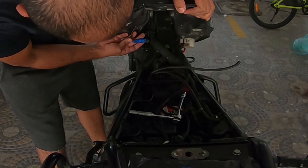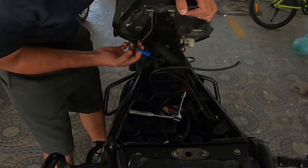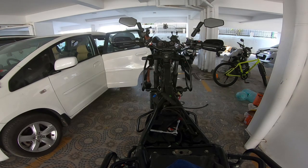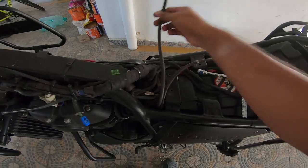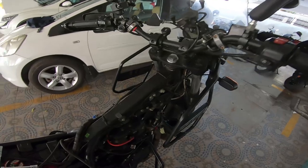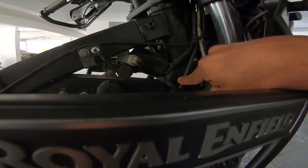There's one more connector — the fuel level connector. Press on it and release it as well. So that's two hoses — one for the overflow drain and one for the evap — and that exposes the top side of your engine and chassis. This is a good time to inspect for cracks at the collar area. Nothing to worry about on mine; my forks are in good order.